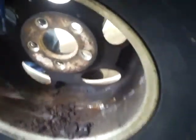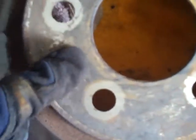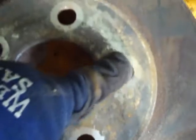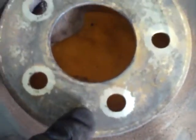It's also a good idea to put a little anti-seize on the outside of the brake rotor where the wheel contacts it, so that next time you take it off it won't be rusted on there. Just paint a little bit of anti-seize on there and make sure you don't get it on the rotor surface — just get it where the wheel touches. That's going to make it easier to take the wheel off next time. I also filed this down; it's not nearly as bad as it was before, but I'm going to file it a little bit more and then get the rotor back on.